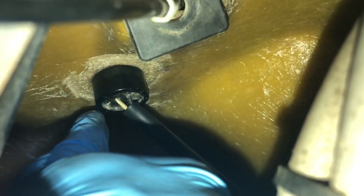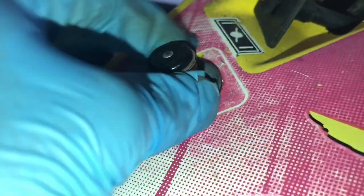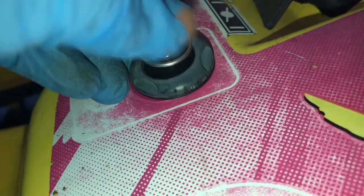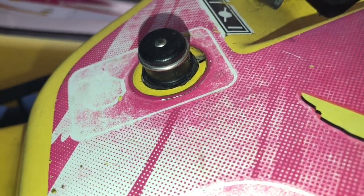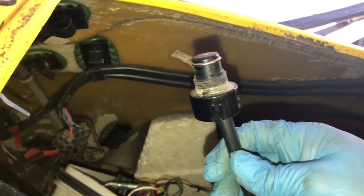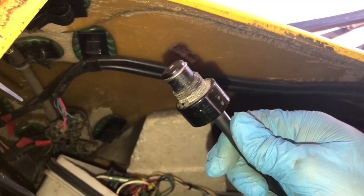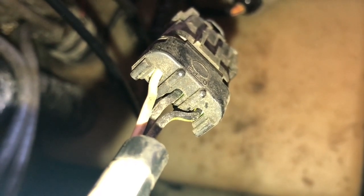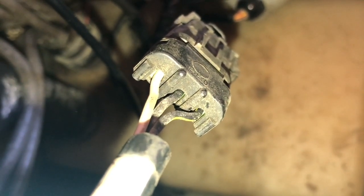Here's the back of the key fob — we're going to pull this thing out. To pull the key fob out, just work your fingers around it and loosen it like you would a nut. If yours is stiff you might need pliers. Now we have our key starter switch removed and we can trace the wires into the electrical box. The one on the left is a white wire, in the middle is a black ground wire, and on the right is a black and yellow wire. We're going to test these.